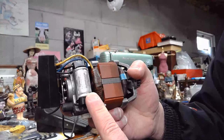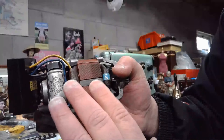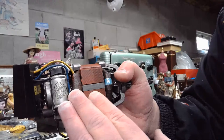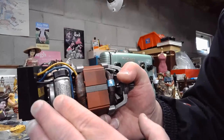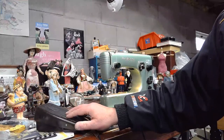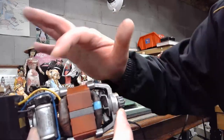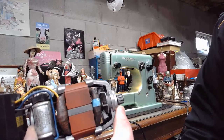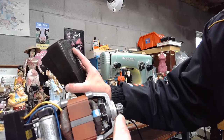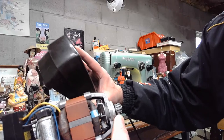It can allow the energy in that motor to be stored back so that when you push on that foot controller, this motor starts up nice and even, and then it allows that reservoir of electricity without any surging to feed this motor, and in concert with the foot controller right over here, it allows that motor to just be silky smooth. But when one of these devices fails, particularly the one that is the gateway for the motor on the foot controller, again, remember the electricity starts flowing through the foot controller and then it's fed to the motor.